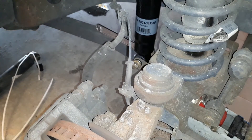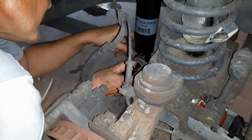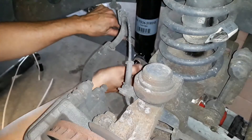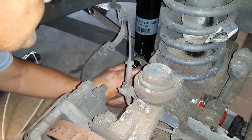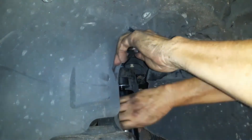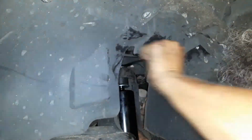It's almost idiot-proof — with those two metal washers, one will only fit on the bottom and the other fits on top. Then I went back through and tightened it down. I wish I would have had a little Loctite for it. I got the wrench on it, tightened it down, then put the breaker bar on it and gave it one more crank — basically the same torque as when I took it apart. Then I used the ratcheting wrench to tighten down that nylon nut, just holding the metal housing to keep it from spinning.